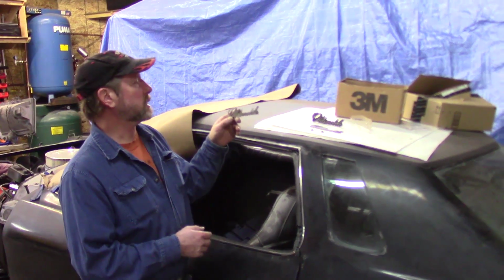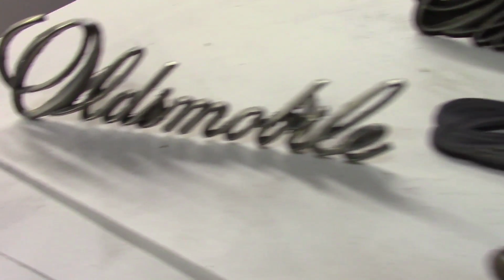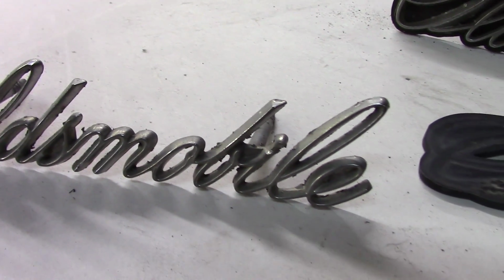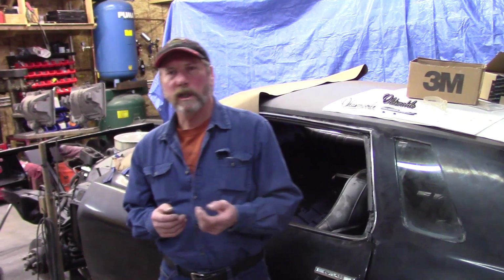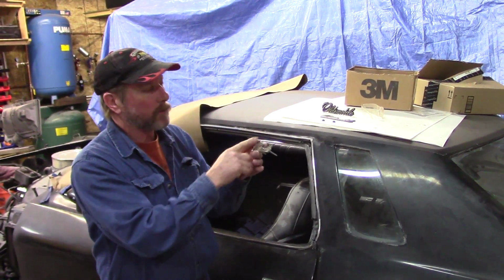So when you have something like this and they're made out of pot metal, what happens is the decomposition of it just gets underneath that chrome that was on the pot metal and it pops. So it's like a big zit and it pops. So the only way you can do this is like if you're watching TV and it comes to a commercial, your wife might complain that you're making her living room dirty or whatever, but put some newspaper down on the coffee table, and then during the commercial time, you got to have these little jeweler's files that can fit in between all these little holes, and all you got to do is scratch them off.